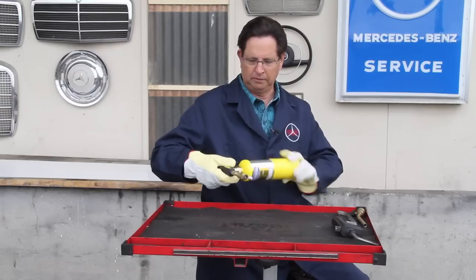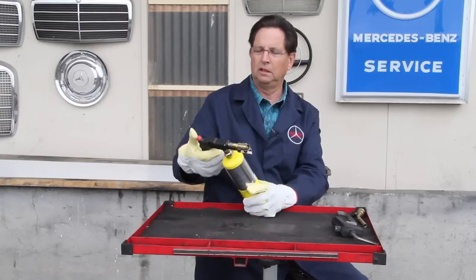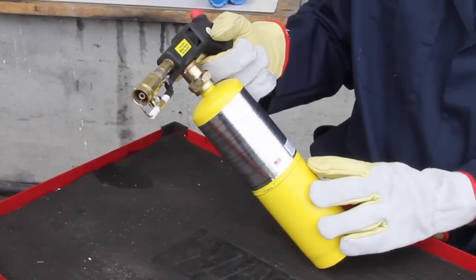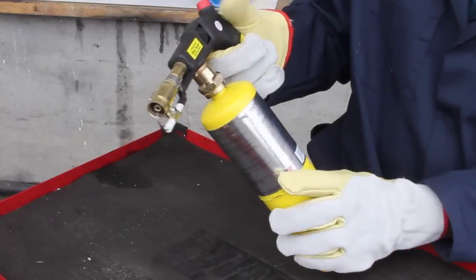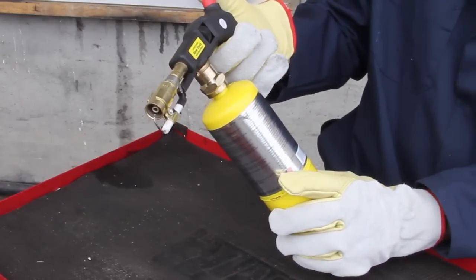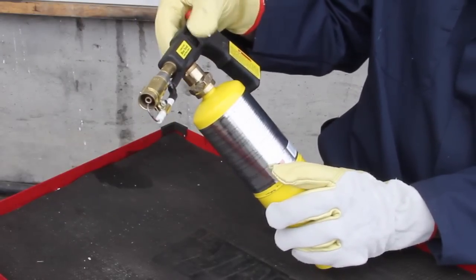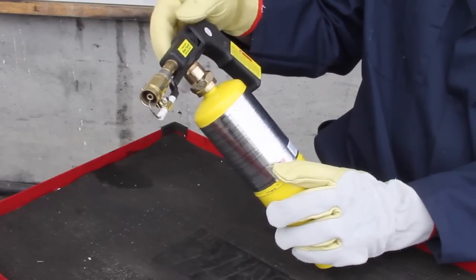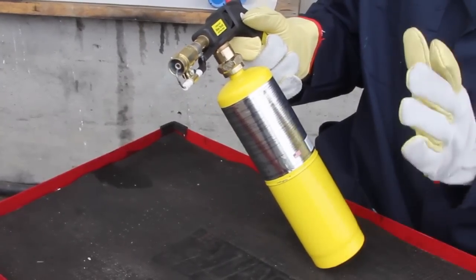Screw in the tank, open the valve, one hit — look at that. Let me show you a closer look at the operation of this torch. It has a piezo starter wire that goes right up into the outlet nozzle, and the starter button is located right on the back of the handle — very easy access to your thumb. The valve which controls the on/off of the gas and the amount of heat is located right in the center of the housing, and you can rotate that easily with your thumb and finger. Open the valve, hit the button, and you have immediate heat. It's very stable.